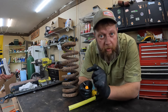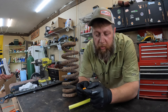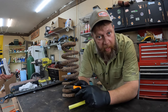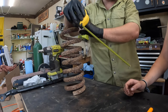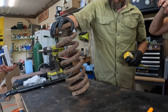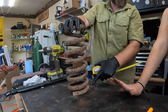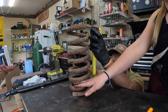Now we're going to cut the spring. On a GM basically from mid-70s to early 90s, if you cut an inch it'll lower it two inches in ride height. We have a two-and-a-half-inch drop spindle, and we need to lower the front five inches total, which means we need another two-and-a-half inches from the spring cut. So we've got to find where the bottom of the spring coil is at one-and-a-quarter inches from the table - if we cut there we will have removed one-and-a-quarter inches, which drops it two-and-a-half inches.